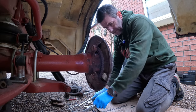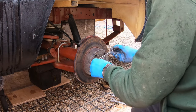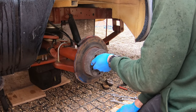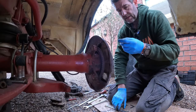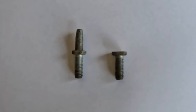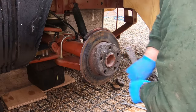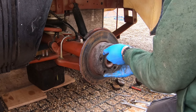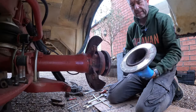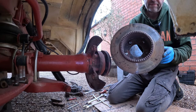Next I want to remove the brake disc. Just here there's a keeping bolt — undoing that. There we go — remove that keeping bolt. Yours may be different; it may have a cone head towards the end so you can locate your wheel back onto your hub. There are two on this disc. That's the one removed — just drawing your brake disc away from your hub. As you can tell, it is fairly thin, that one.